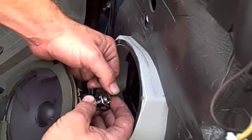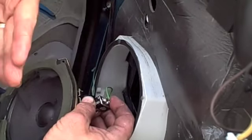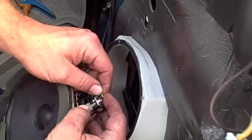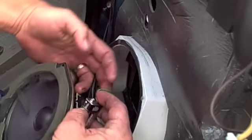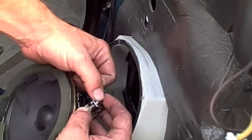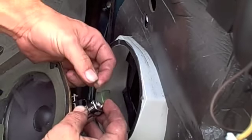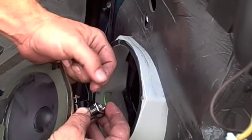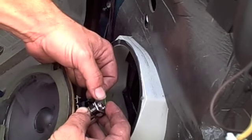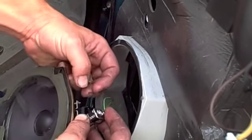Can you see that? When I tap it with the battery, it moves out — which means the speaker's coming out this way first. If I flip the battery, the speaker will move in the opposite direction first, so it'll go backwards towards the door. What we're looking for — positive polarity, or in phase — is the speaker going to come out first. When it does that, it makes your speaker work correctly and it's in phase so that you have depth and bass in that speaker.